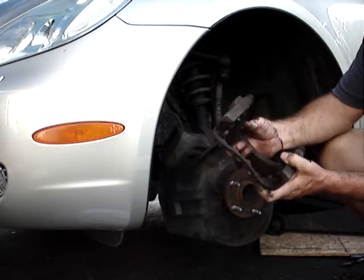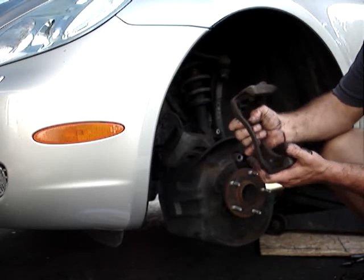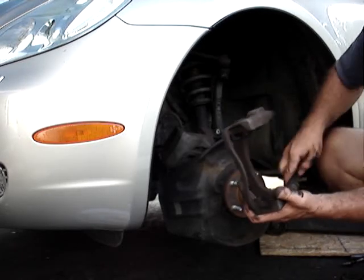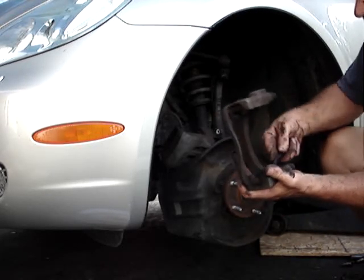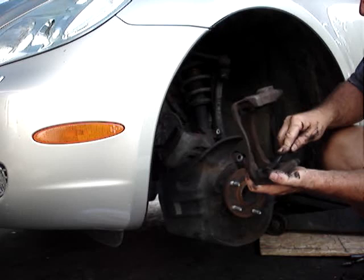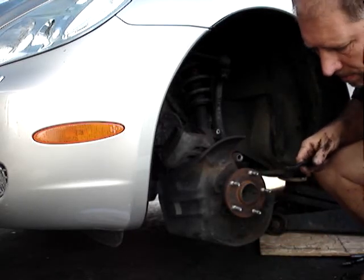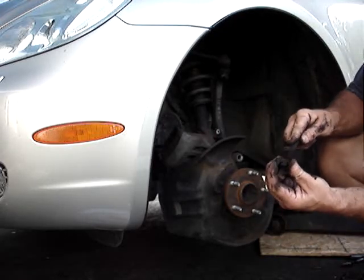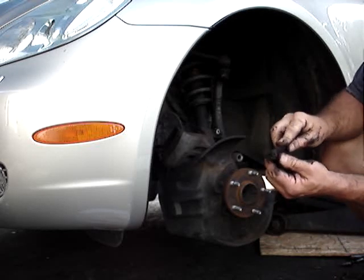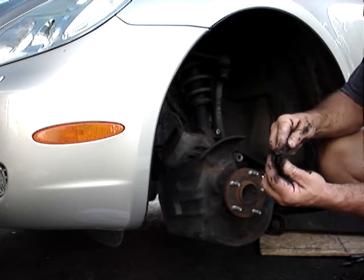If you don't take the clips out and clean it, it'll build up under there and close the space — the pads will either not come out or be hard to go in. When you press the caliper, the pads won't slide freely, causing uneven brake wear. Toyota factory pads don't come with hardware, but this isn't rusted so I'm going to reuse it. These are pretty clean so I'm just going to clean up with my wire brush — top and bottom surface, make sure there's no rust on the bottom either.